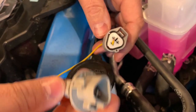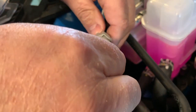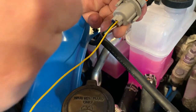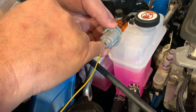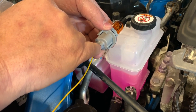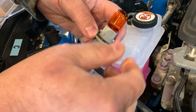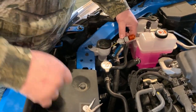So now we're going to take this plug with that wire shoved down in there, and we can plug this right back in now. And now the wire is hooked in and pinched by the clamp. What we're going to do in here is fill this hole full of silicone, and that will seal it up and make it back to a watertight connection, which is what you want. All right, we did a little more cable management here.